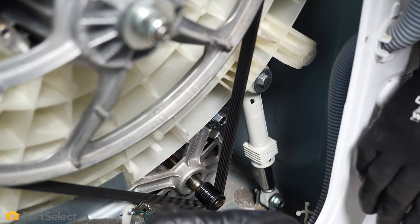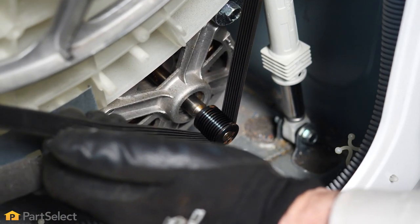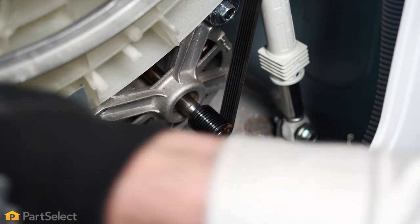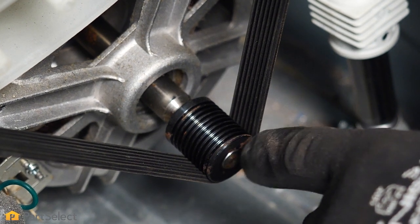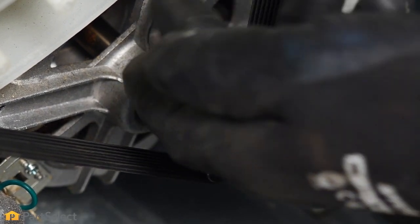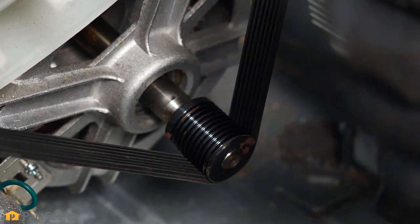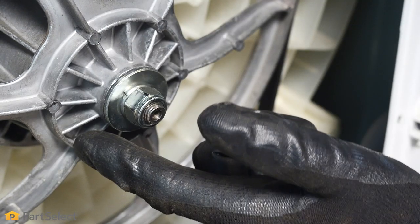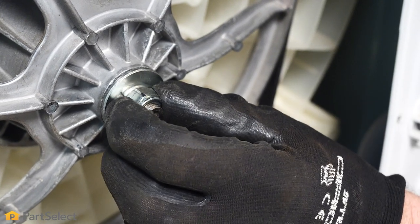The motor pulley has more grooves than the belt does, so we simply need to shift the belt back and forth to make sure that it's centered on that larger pulley. Put a little tension on it and allow it to roll into the next set of grooves on the motor pulley. Now we have the belt pretty well centered. Just make sure that it didn't ride up onto the edge of your motor pulley. If it has, you'll need to check the adjustments on your motor to make sure it's mounted properly, and check the driven pulley to make sure it is fully seated on the basket shaft and that the nut is tightened to the manufacturer's specifications.